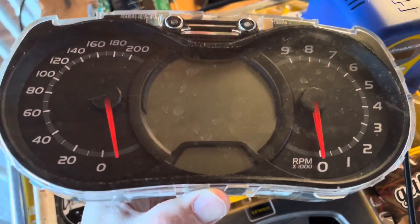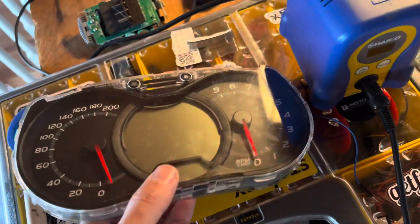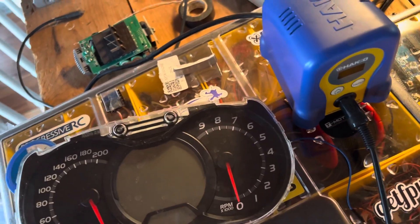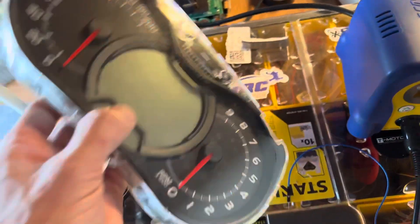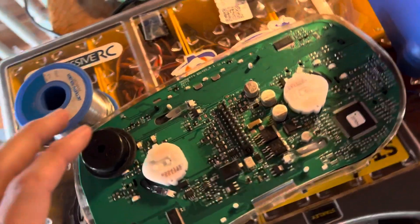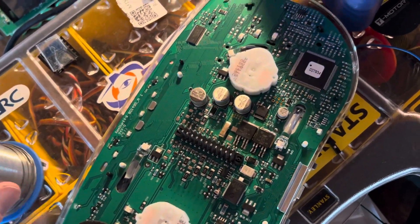When you press the button to turn the heater on for the thumb or the grips, it will show an electronic readout of the level of the heater on the sides of the gauge, and the gauge is actually controlling the circuit that turns the heater on. In my case, my grip stopped working — thumb heater still worked, but the grips didn't work.